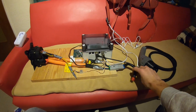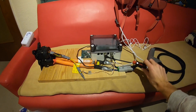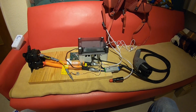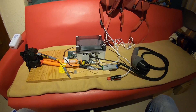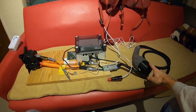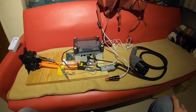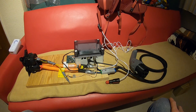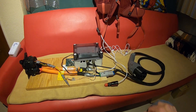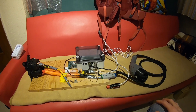Next up you see this little plug here — it goes into the cigarette lighter of your car, and that's needed for logic power. We need to power up this controller and the car that runs CHAdeMO, and that needs 12 volts. The Chinese equivalent has a little battery built in, which is recharged on every charge session from the high voltage, but this one doesn't have it. Then there's the CHAdeMO plug, and you might be able to spot that it's 3D printed, with some handmade brass pins for power conduction. I don't think it's really up to the job for sustained high current — I've been running it at 80 amps and the pins get remarkably warm.